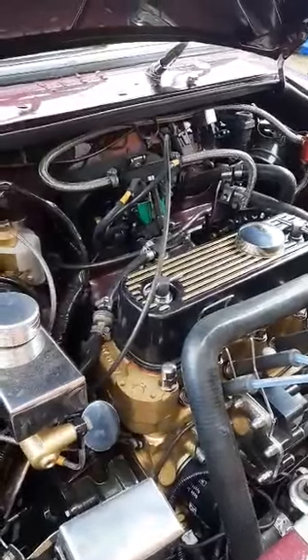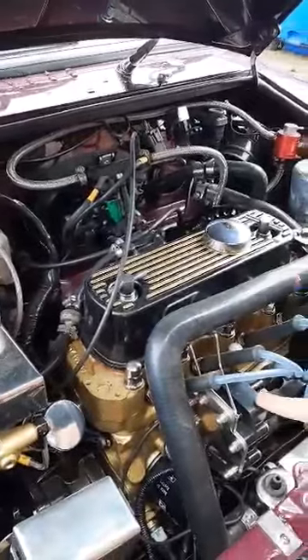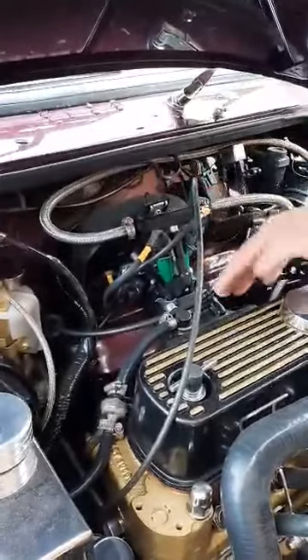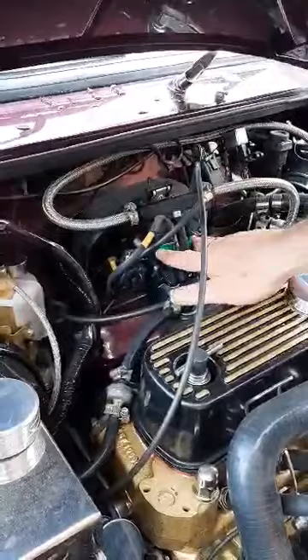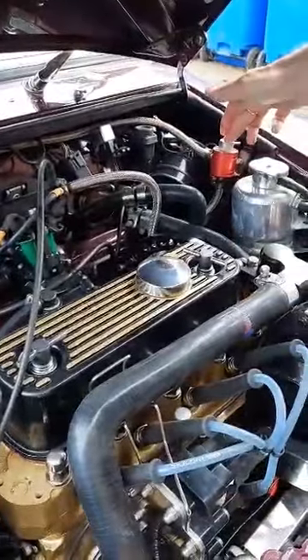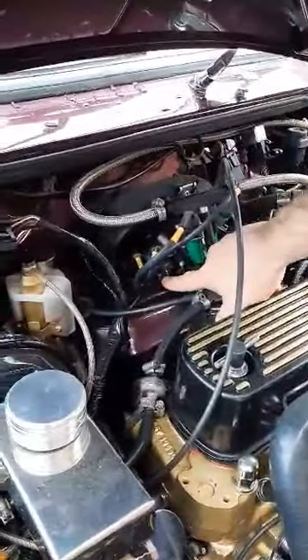This is an MPI Mini, which is a late model coil pack. The kit is effectively the same whichever model of car it is, so this part always stays the same. With this kit you get an inlet manifold, throttle body, two injectors, the wiring, regulator with plumbing instructions, and sensors. It has a throttle position sensor — there's no MAP sensor because this is an MPI.